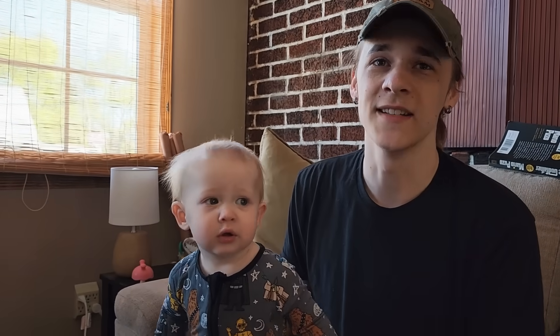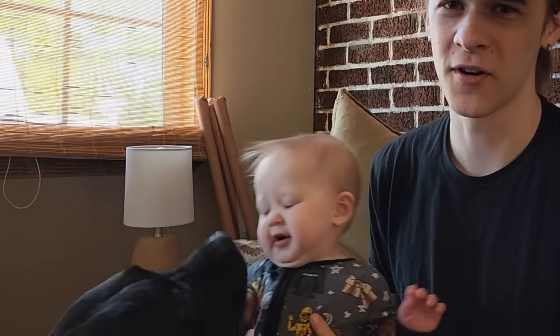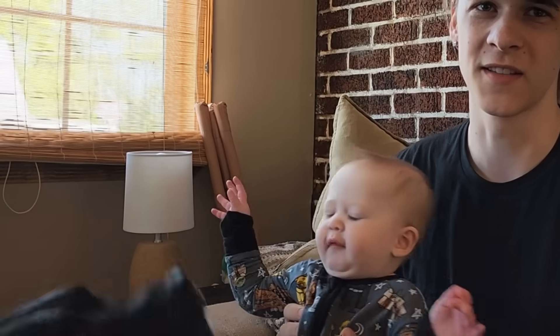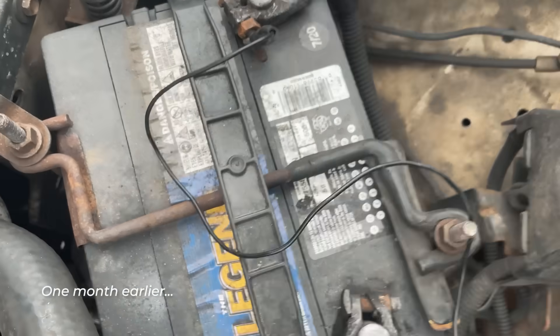We did do a little preliminary stuff. I had Caleb doing some testing with a test light and we saw what we didn't expect to see, so he called me and we said we have a voltage drop. It's definitely a wiring issue to the starter because of the starter's heavy post. So let's insert Caleb's footage here. We got the test light connected to battery ground with a jumper wire.